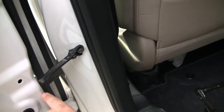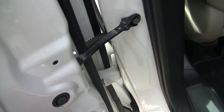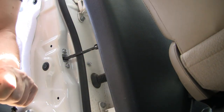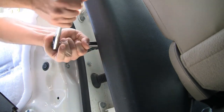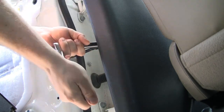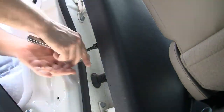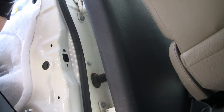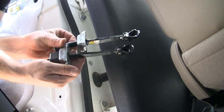So what we're going to do now is loosen that bolt here. There are two bolts here on the left side — you see them? Take these out. This door stopper will fall in here; we'll reach up there and grab it. This puppy's really in there, so you might have to use a little bit of muscle to get it out. There we go, there's that one. Now let's put in the other one. You can see that there is a difference between the two — the left top one is what we're putting in, the bottom one is what we're taking out.